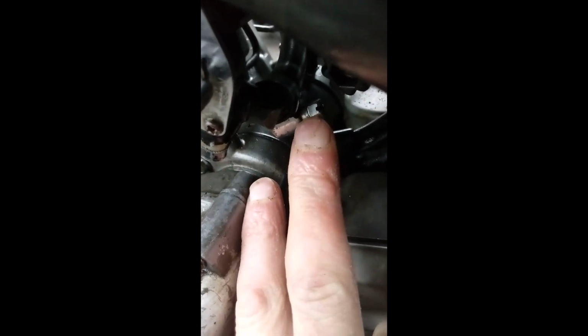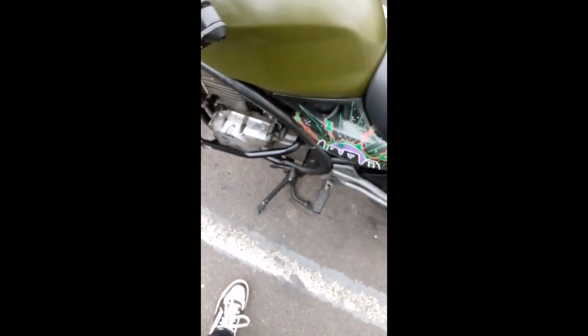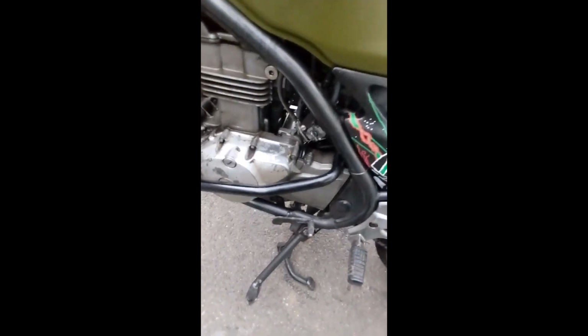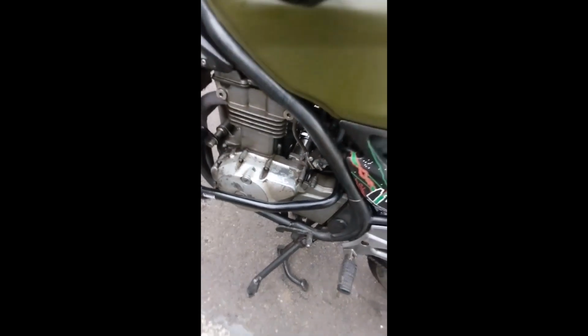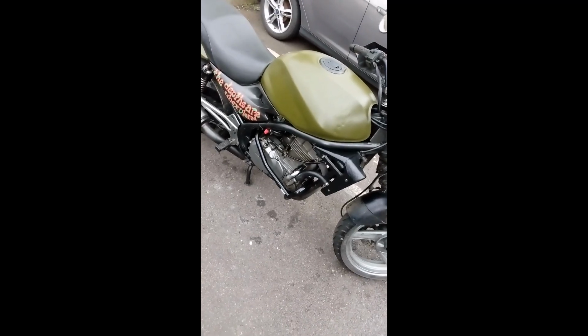I've just noticed the end of this new hose is starting to fray a bit, so I'll keep an eye on that it isn't splitting back. These type of clips can damage the hose because they get out of shape when you tighten them, which can cause some damage to the hose. So I'll keep an eye on that. But yeah, I hope that gives a bit more clarity to the fuel tap thing. I'm still using the original vacuum petcock because there's no fuel pumps on these bikes. They have to have the vacuum petcock to work, but it's just got the extra tap in there for belt and braces. So anyway, thanks for watching, and catch you soon.